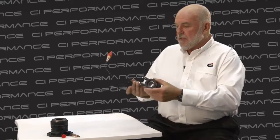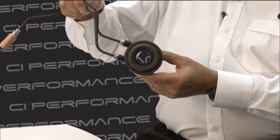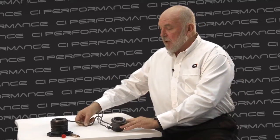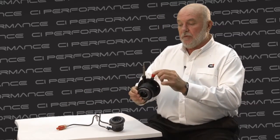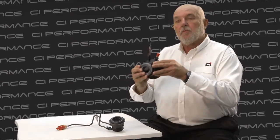As you can see, some of the plumbing on a CSC is very complicated, and what it can do is allow air to get into the system, which means it doesn't work effectively. So one of the tips is to prime the CSC with fluid through here before putting it in the car, so that the CSC is full before it goes in.